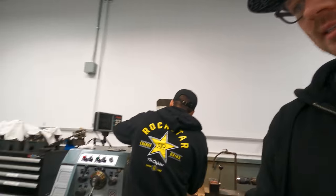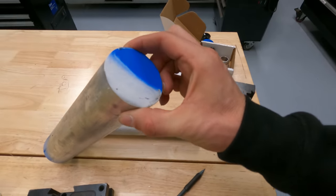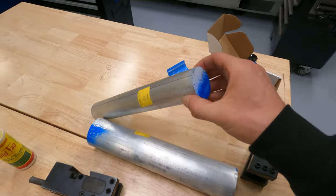And these are gonna be for the scavenge oil pump, the inlet oil pump, the two inlet water pumps, so that we can start building those lines and have those all dialed in and ready to go when we get the cooling system and the oil system all set up. So they're all gonna be custom done. We have 2.5 inch aluminum, 1 7/8 inch. Oil system's gonna be all -12, and the cooling system is all gonna be -16. Let's get to it, man.